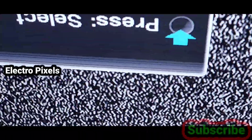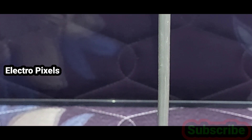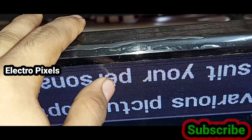You can see the result — the white shading complaint is solved successfully. There are some minute horizontal lines because the other side of the panel is also partially faulty. I observed that after working for more than 10 minutes, the minute horizontal lines are slowly disappearing from the screen. Otherwise it will not be a problem for watching videos — the TV is working okay at present condition.